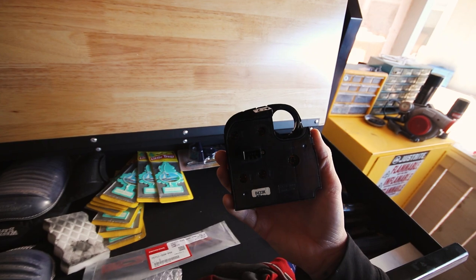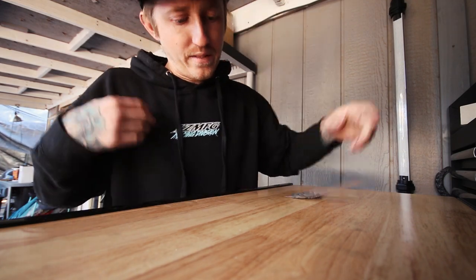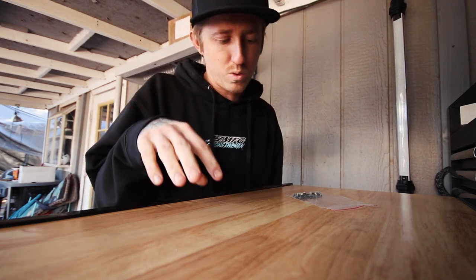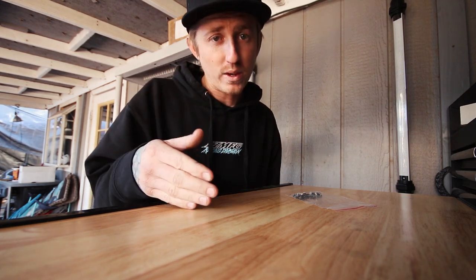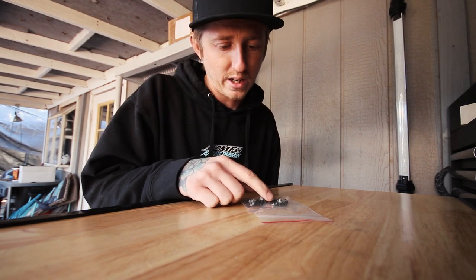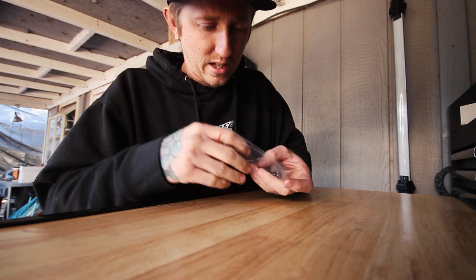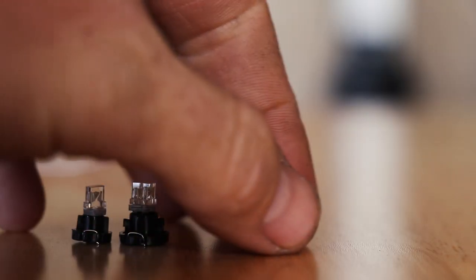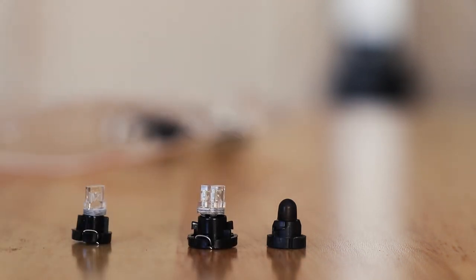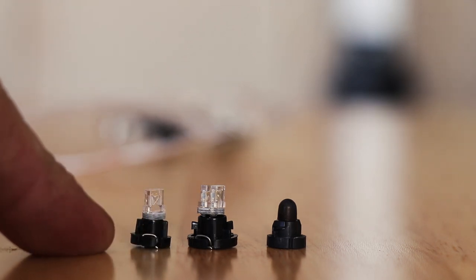This is a spare bezel - I'm just gonna bolt it straight into the car once I take the cluster out so I don't have to pull the LEDs out again. I ordered these LEDs from a website called CT Illumination - they're about three dollars a piece and we have a whole bag of them. For the S2000, the forums say you need a total of 12 bulbs, which I believe are type A. For the type comparison: the factory bulb is on the right, the larger type B bulb in the middle is for your AC and climate controls, and the type A on the left is what you need for the instrument cluster area.